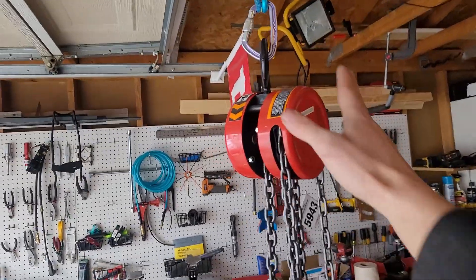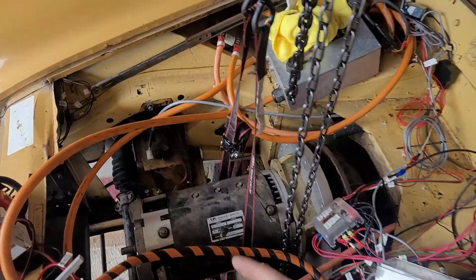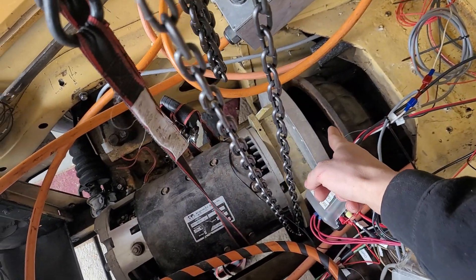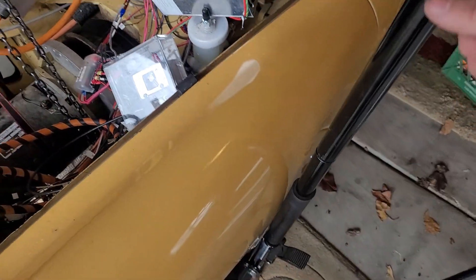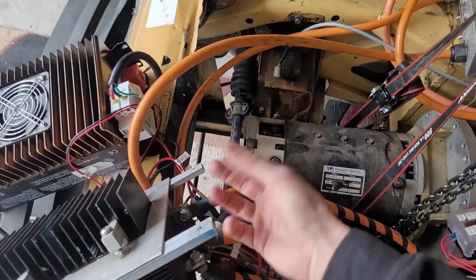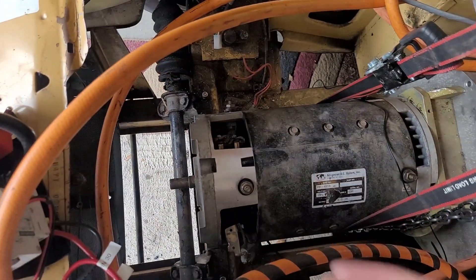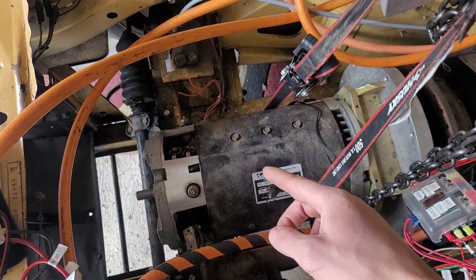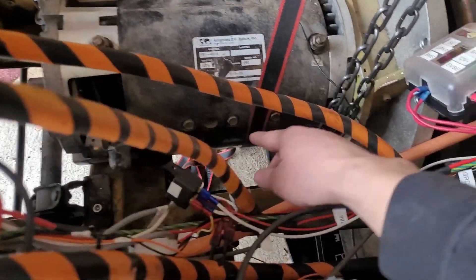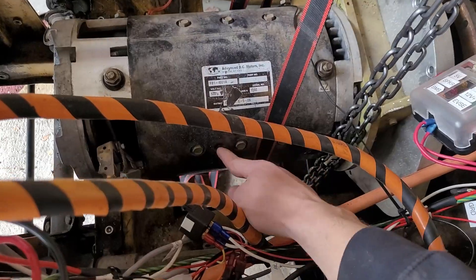To lift the motor out I had to take the hood off. I bought this $40 chain-style lift — I did a pull-up on it; I weigh 170 pounds and this motor only weighs 140, so it can lift it. I'm getting tension off it from the transmission, which I have slightly jacked up. I had to take the controller out and peel it over because the shaft was starting to run underneath. I need this to slide, so I'll thread an eye bolt in later.